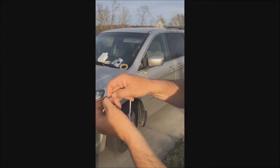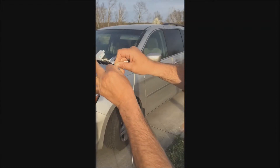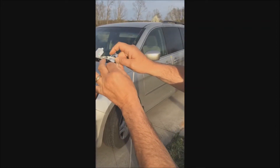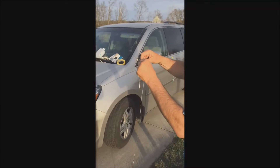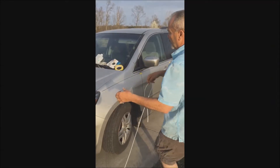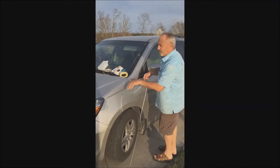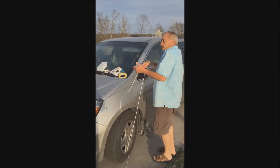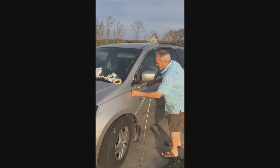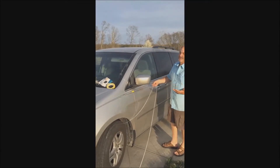It works pretty good off the backing paper. It's two lines of vinyl — it's got a clear carrier on it, because otherwise it'll stretch if it doesn't have a clear carrier. Many times we just pinch it like such, put our thumb through it to get the stripe going. It's very fast — you come up, you go down and up, push your thumb through it. The front fender is going downhill, so it's hard to stripe going uphill. I usually start the stripe right about here where my marker is. We usually eyeball it.